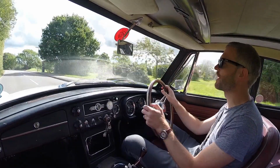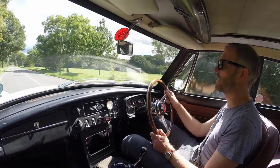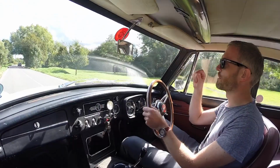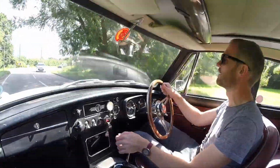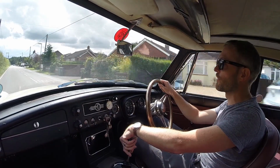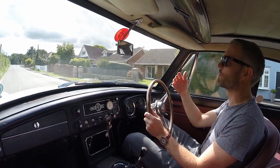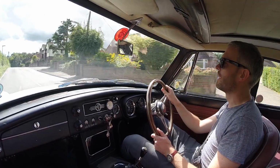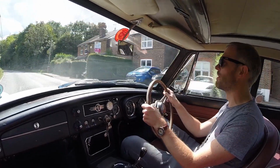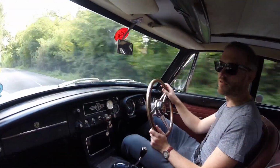I guess the other thing I should mention is I have fixed another exhaust leak on the exhaust system. In one of my earlier videos, when I went to the Vista Heritage Sunday Scramble meeting, I had to fix an exhaust leak. This time I've got exactly the same problem, but from a different joint in the exhaust system. I don't know whether the place I took it didn't tighten up the joints properly or didn't fit the gaskets properly. The one I fitted before is fine, and this one is at the joint between the manifold and the rest of the system. The gasket had perished and the gas was escaping from there. So I fitted a new one. It seems to be holding up on the driveway and I couldn't feel any leaks, but after this run we'll see if it's still okay. Fingers crossed, because I'm running out of spare gaskets now. But we'll see how we go.